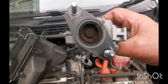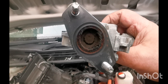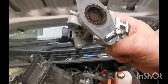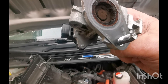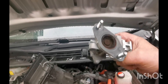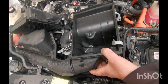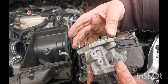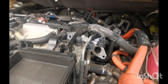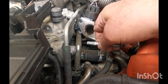So I thought I better take it off. As I took it off you can see it's all EGR blocked up from inside — it needs cleaning up or might need replacing. I had to take the EGR valve off, take the intake units from here, and also remove two bolts from the back which are fitted in there, and one bolt which goes over here into this portion. I had to take this off in order to slip it out.